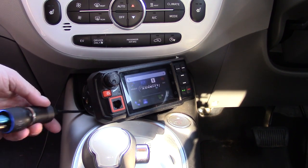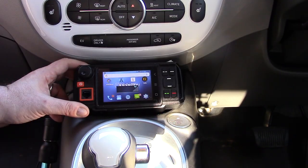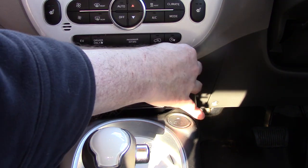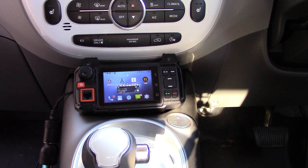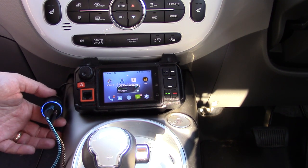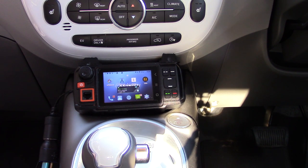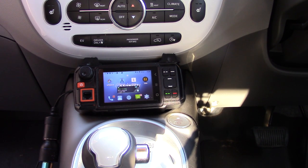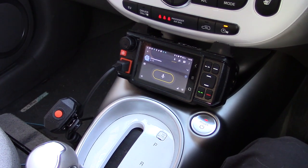You can see it is powered up. We ease it into position and put the door wedges in — and we have it installed. That's quite a neat installation. The power lead comes out the side for any additional accessories you want to power, so you haven't lost your socket. The GPS is tucked back there. Obviously there'll be different installations in different vehicles — if you need a longer cable to fit it into the central well, use one of those cables shown earlier.